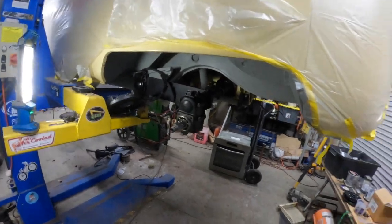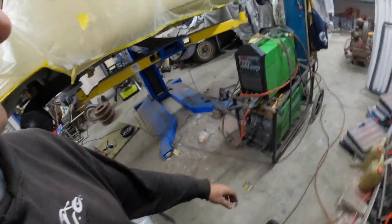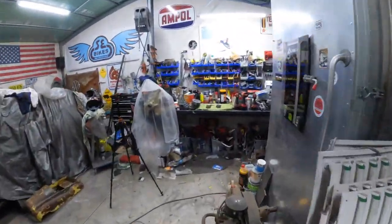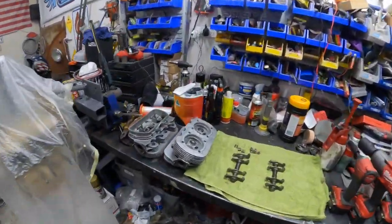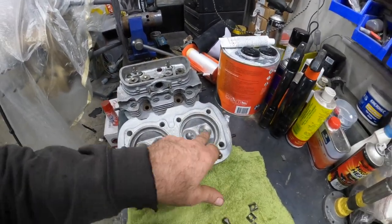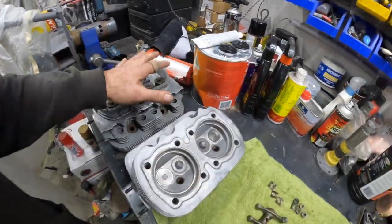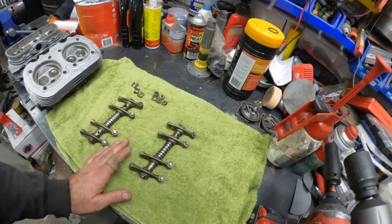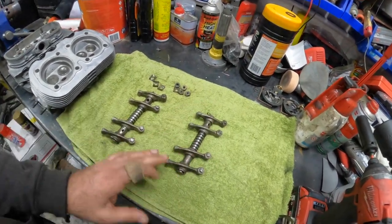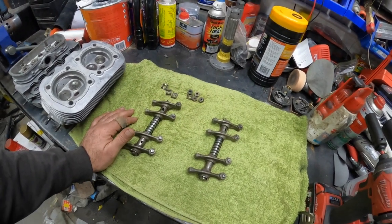Now, one more thing, the heads have arrived. I can show you those down here. That's from a local shop here in Mornington, did all the valve stems. You can see here they did a great job. Brand new exhaust valves. I think the intakes were okay, and then springs. So they're good to go. Obviously, these need to be cleaned, and I want to get these shafts polished. So we're going to quickly pull these apart and clean them up,